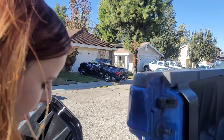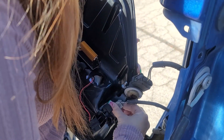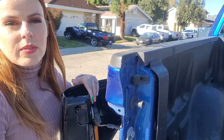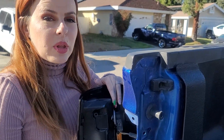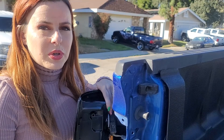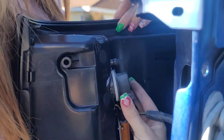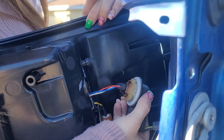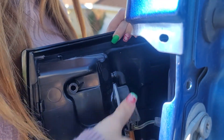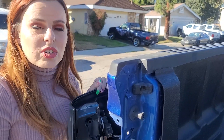The little LED goes down here at the bottom. So for the other side — we didn't show it — but the pieces that we originally twisted out to pull out the bulbs: you have to make sure that once you make the connection with the wires to these pieces, you put them back into the socket they came out of. I'll untwist it so you can see. This is the connection we made. Once it's completed, we put it back in, twist it, and seal it so it locks — and that protects the electrical pieces from water.